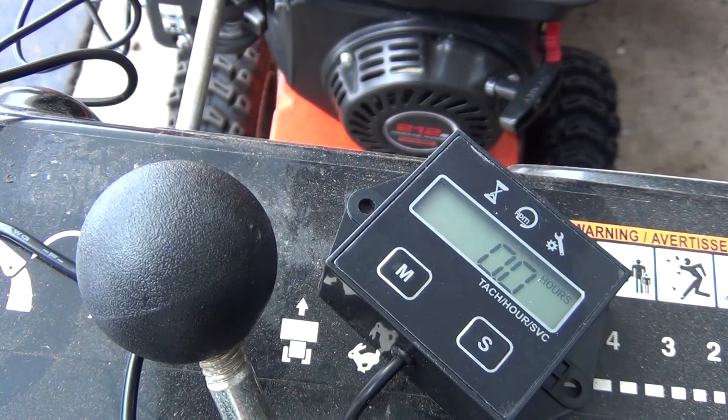As you can see, we were running about 3,400 to 3,500 RPM. Our manual with the original Subaru engine called for a running RPM of around 3,600 RPM, plus or minus about 100 — that's typical for small engine applications. So we are running a little bit slow, and I'll back out that screw slightly in order to reach our 3,600 RPM target.